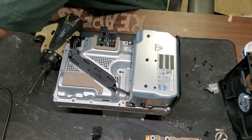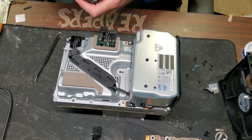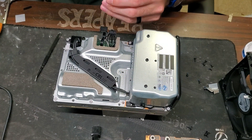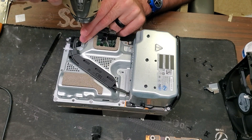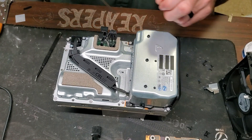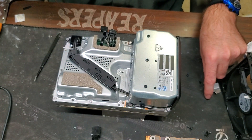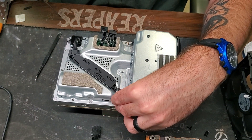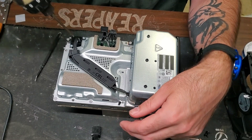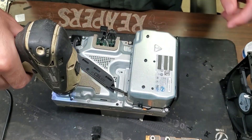I'm also going to change the battery real quick. Now for the medium screws — the only reason I do these next is because they hold this little power connector in really well. Then we do all the small screws. Remember this one had a cover over the top, so put a small screw in first, then grab that cover and another small screw, lining it up on the peg and in the little slot. Screw that in and continue screwing in the rest around the sides.